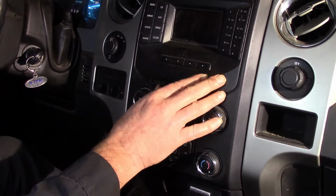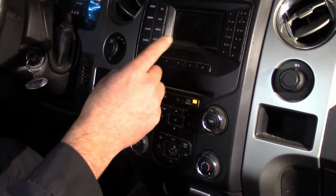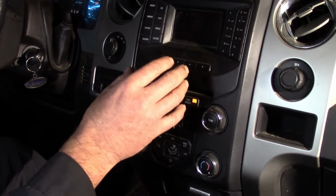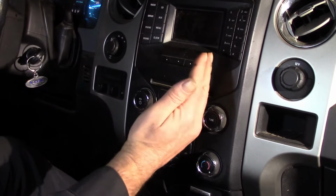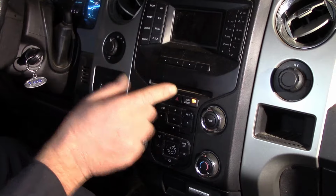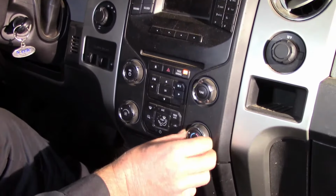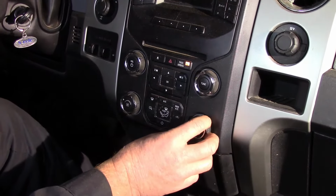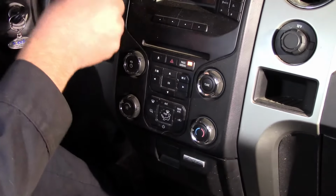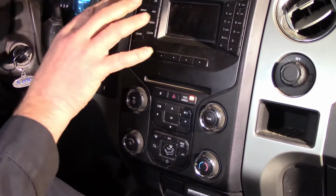Because if the door is stuck, then you often hear a clicking sound as the actuator is struggling to try to move the blend door. We don't hear anything. I stuck my head in there, can't hear a thing. When I go from here back to there, there's nothing. So it's like the motor has stopped working. So we need to get to the motor.